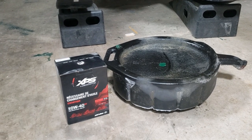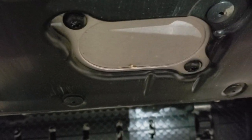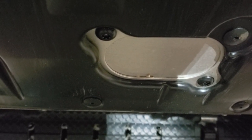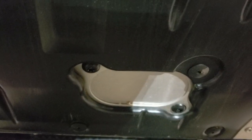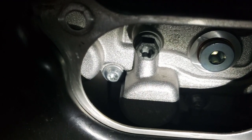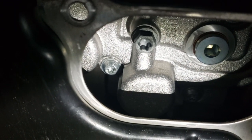It looks like there is a plate in the description in the owner's manual with T32 and T30 screws, so we'll take this plate off and see if we can access the drain ports — there are supposedly two of them. The port cover came off; it's up inside the unit so you have to do some gymnastics to get it out, but once you do it's not that bad. It reveals these two drain plugs. The owner's manual is very clear that both have to be undone, so let's do it.